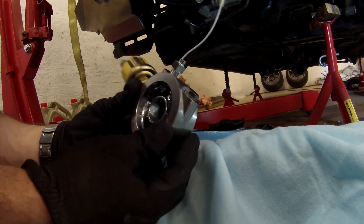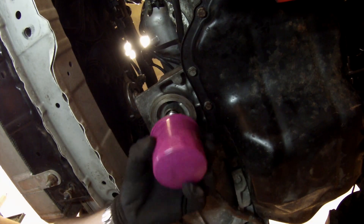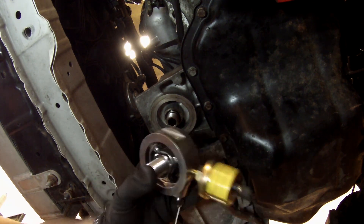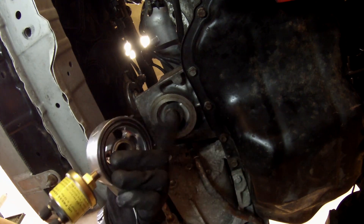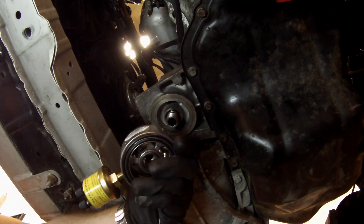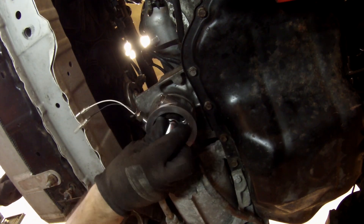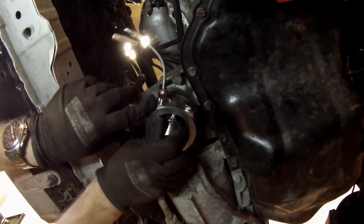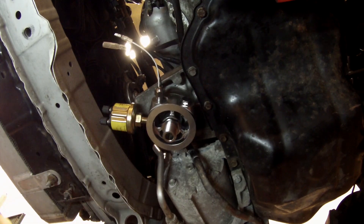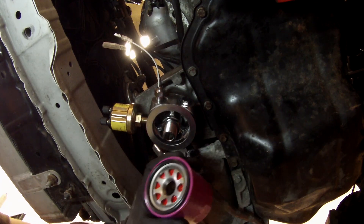Let's mount it up into our car. This is the place where your oil filter usually mounts. Now we're going to install the sandwich plate onto it, using the side that has the o-rings. You may want to put some oil on the o-rings first. Then using the adapter, just mount it up and make sure it's really tight — you can use a socket. I'm just doing this for illustration purposes, so I'm not going to tighten it up. Then just put your ordinary oil filter in there.